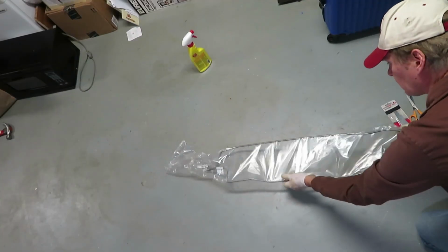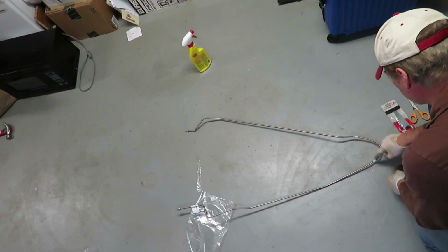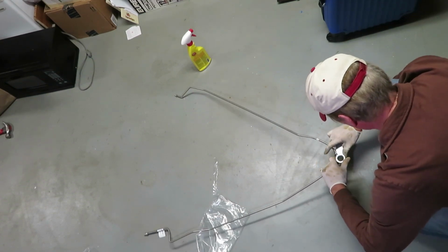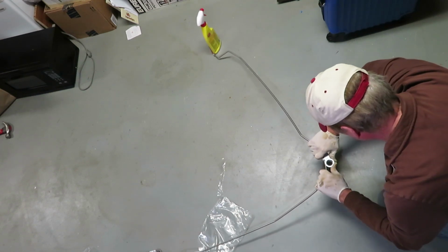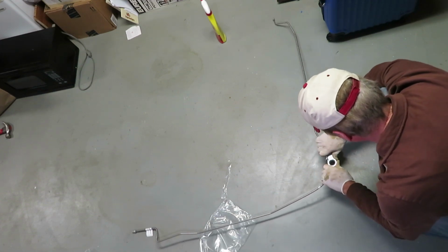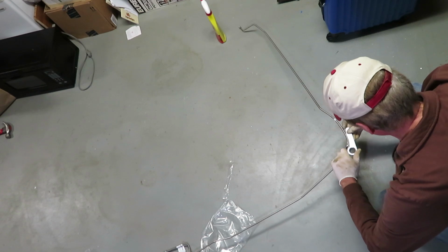The next piece that I'm going to install, going back from that center hose, for shipping purposes they bend it, and there's a couple pieces of tape on there. You can see the 2 white pieces of tape. It needs to be straight in between there, using a hand tubing bender, just gradually and carefully working it straight. A little of this and a little of that. This is pretty stiff stuff, so this tubing bender is a little undermanned as far as getting this job done. And I continue to just work it.